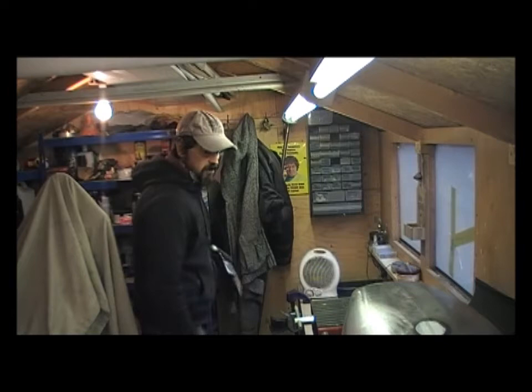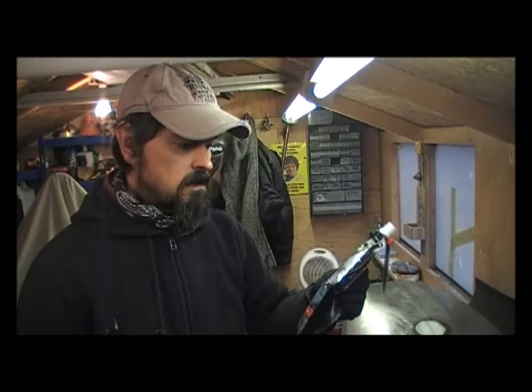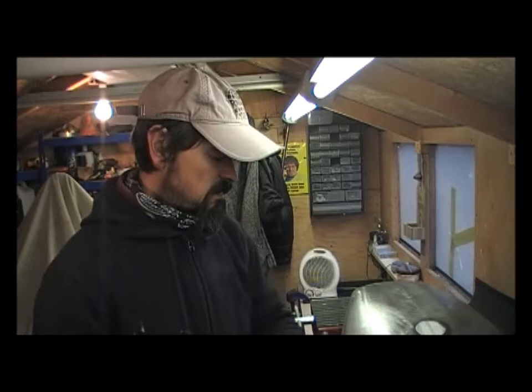This is what I use for very fine work when it wants a skim over — it's called dolphin glaze. You get a hardener with it, it's very liquidy, like the consistency of salad cream, so when you squirt it out and mix it up it's really runny. There is a bit of a bad weld underneath which I'm going to grind down a little bit to make it look nicer when it's painted. Al said to leave it, he ain't that fussed, but I think it looks bloody horrible.